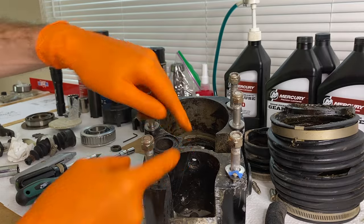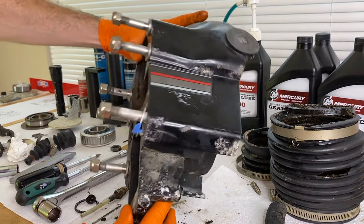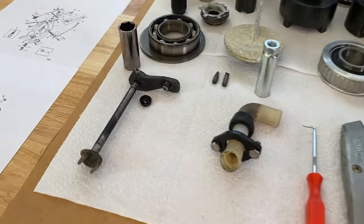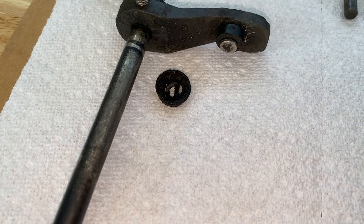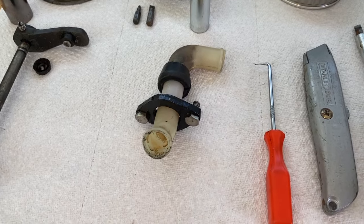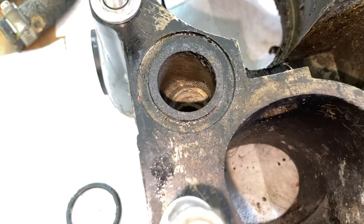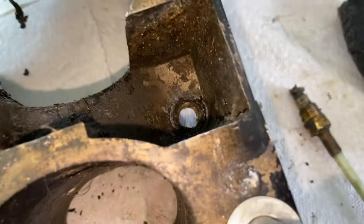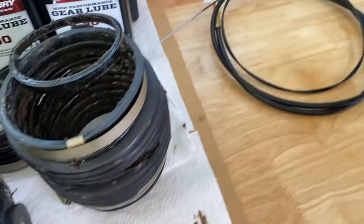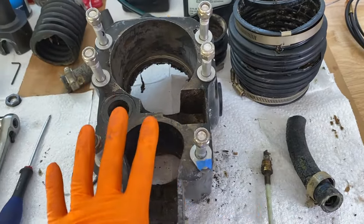At this point, there is a bushing inside both openings — we're going to leave those installed but clean up the inner portions. DIYers, your entire bell housing is now a hollow case. A few things before we end part two: for that little gasket we just removed, take photos to ensure you properly position the new one the right way. We're going to keep the water tube but install a brand new cover and bushing. The O-ring for the water tube will be new. We'll clean everything up and install all brand new parts for the shift cable fitting.